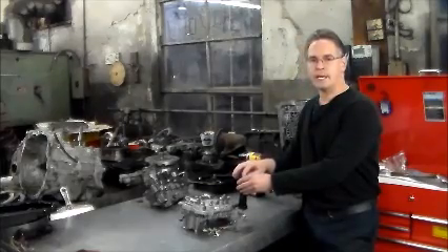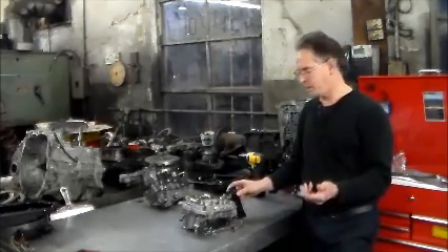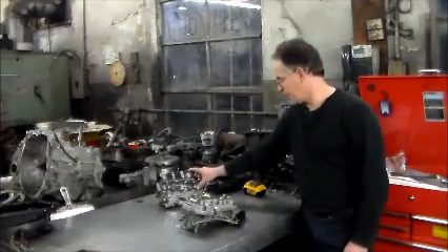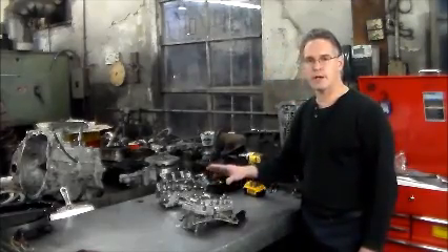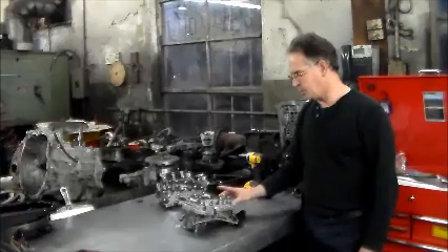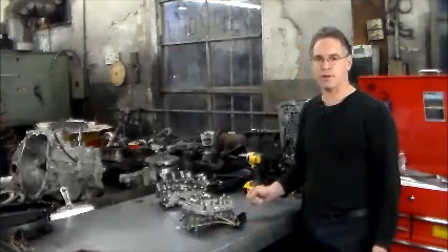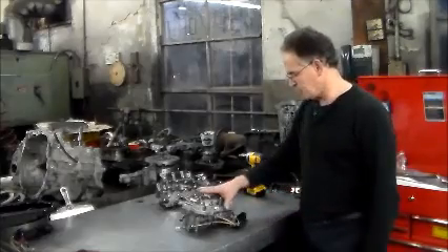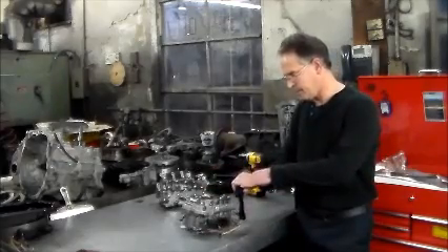It ohmed okay, but the weird thing is you really got to drive this thing to get this code to set. It's not a hard code, which makes it more difficult to diagnose. Since I have another valve body here out of a 2012, we're going to talk about this in a minute because there were some changes. The solenoids are the same from 2009 to 2012. So what I'm going to do is swap out the SLT solenoids as well as the internal harness to see if that will fix the car. If that doesn't fix it, then we know it's a computer, because that's really all it can be. With this one, it's very hard to check anything because the TCM is mounted right here — no wires at all. The only wires coming in are the powers, the grounds, the bus wires, stuff like that.